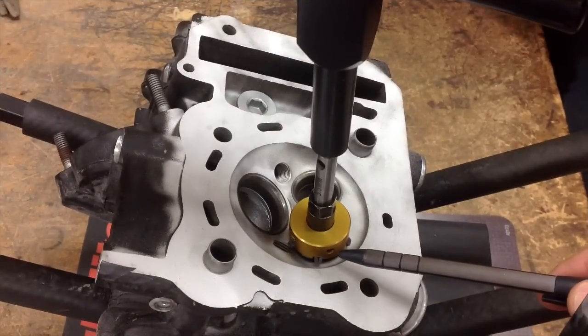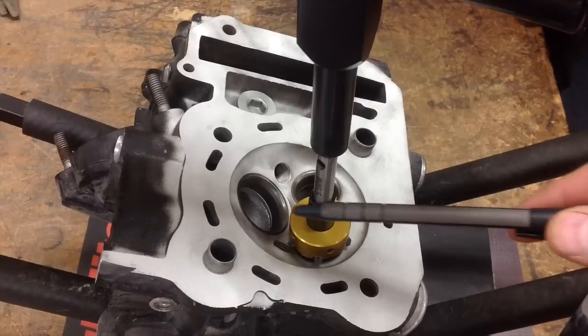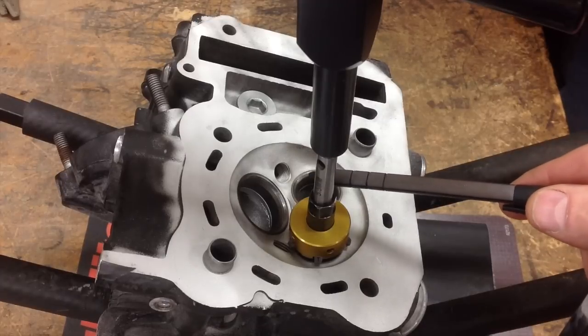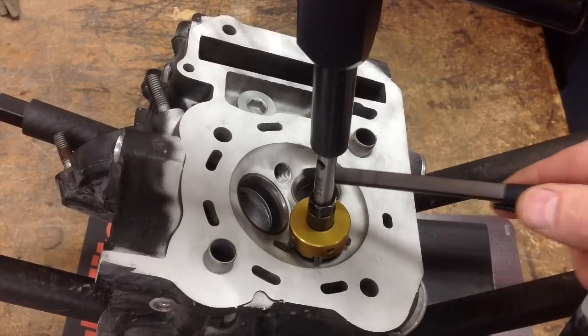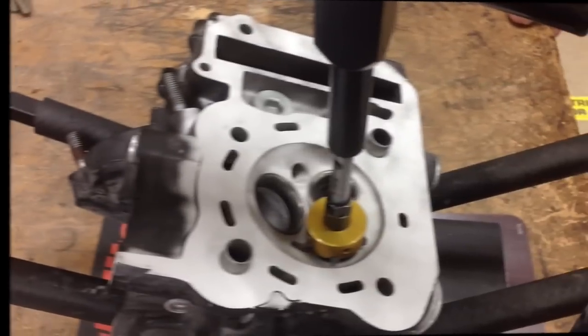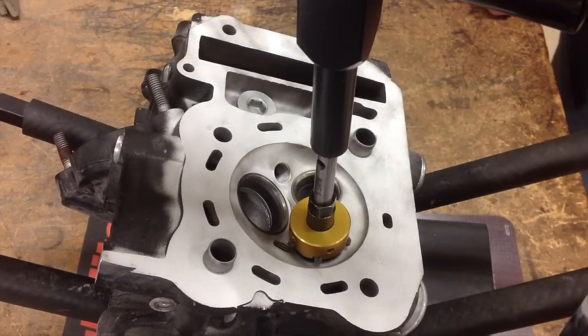He's not going to be taking much material off — we're just going to be dressing those up. You can see the exhaust seat there; there's just some slight pitting in it, and there's some slight pitting in the intake seats as well. So that's the reason for going through to do the cutter head on this. At the beginning of the cut he's going to have very light pressure — I'll call that dwell — and then he's going to apply pressure, and you'll actually see the dust from the seat start to get kicked up. Then at the end of the cut he's going to dwell again, and then we'll inspect the seat. We'll do this as many times as necessary to come with a clean cut all the way around the seat.